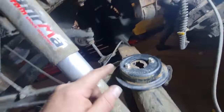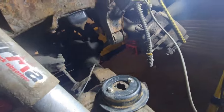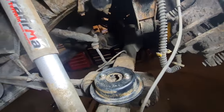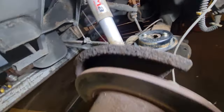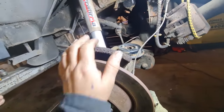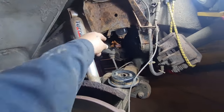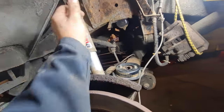Right, so that's the bottom plate that the spring sits on now. It's just a couple of bolts through there. The original ones, the thread is knackered on them, the captive ones that are underneath. So we've put these through, we should do the same job. We'll tighten them up. And the spring has to be pushed in there and onto there. So we'll probably have to compress it, because even though we've undone this, we still haven't got a massive amount of movement because of the radius arms and the anti-roll bar, we don't want to unlock that really. So we'll end up compressing the spring.